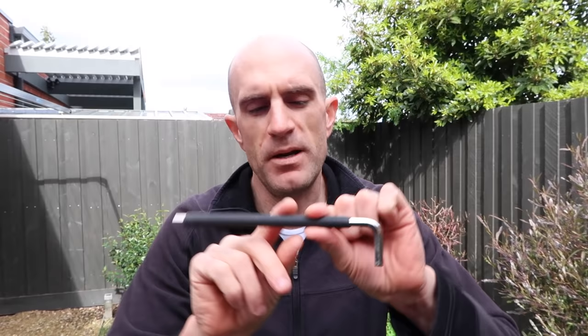The tools you'll need are either a 15mm spanner wrench or an 8mm hex wrench, a large Allen key. I've actually taken the end off this one — a bit of a hack tool tip. Usually they come with just that end exposed, but I take it off because once you actually loosen the pedal, it's easier to spin it out that way.